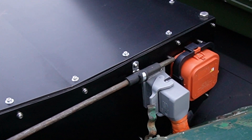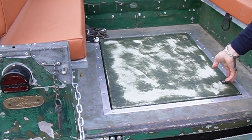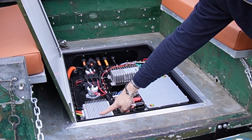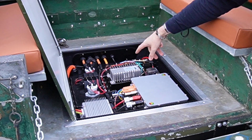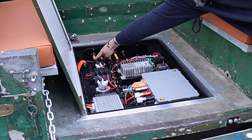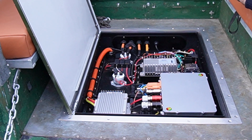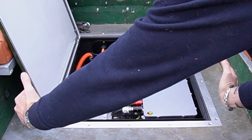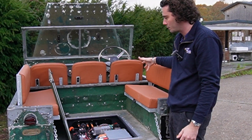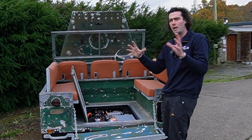Let's have a look at the back where the fun really happens. This is where things start looking a little bit different and where our design has changed. If we open this up, this is actually where the majority of the wiring sits - the majority of the gubbins. The BMS is there, the charger is there, that's the DC-DC converter, we've got the contactor circuits, fuse boards, a whole lot of 12V wiring, as well as the cell tap wires going up to the front - four HV cables going forward to check the voltage and current of every single cell. This box sits in a void between the chassis rails, which we thought was best utilised especially in a smaller car like the Series 1. We're going to start implementing this on our next builds - Series 1s, 2s, 3s, and possibly even Defenders, even though Defenders have a little bit more space up front.